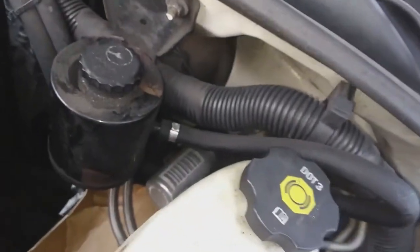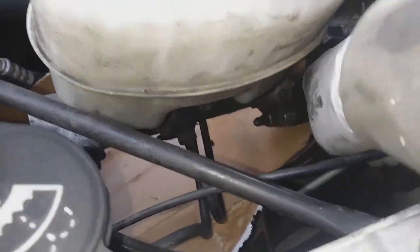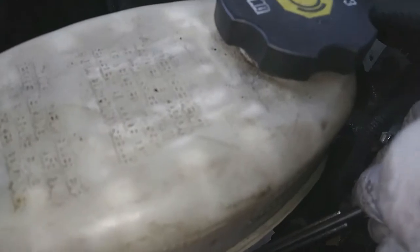First of all, I'm going to get my brake fluid level sensor. Get that unplugged, moved out of the way. So it's a little clip. You want to pry back on that clip there and pull back. It should come right off. As long as you pry, you release that clip and then pull back. Okay. So let's go ahead and get these lines loose.